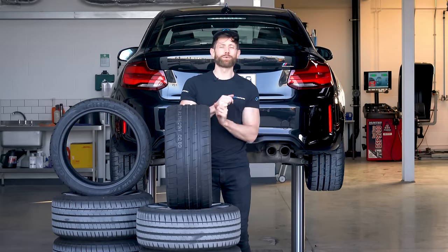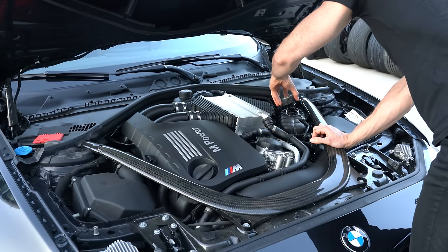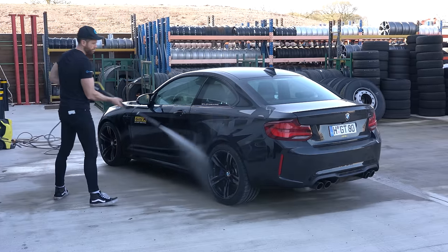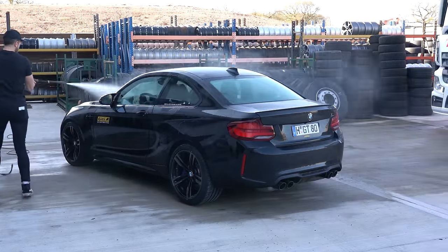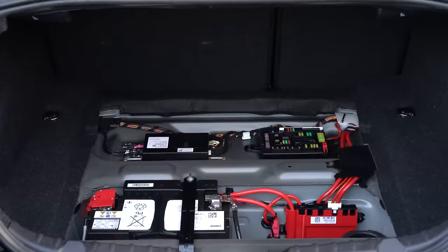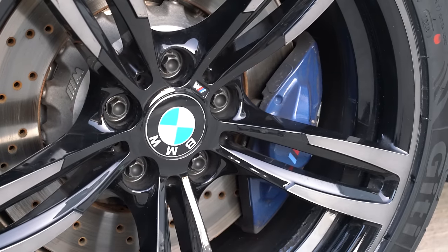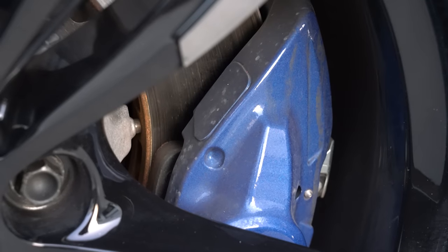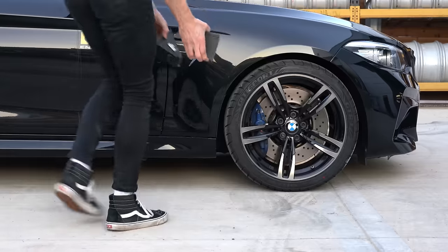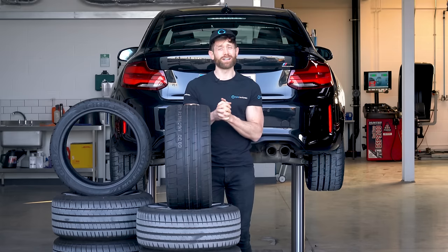Bonus car tips. Now's a really good time to give your car some love. Give it a visual inspection to make sure the doors aren't going to fall off, open the bonnet, check all the fluids, check the oil level and top up if needed, and give it a good clean inside and out. If your car's going to sit for more than a few weeks, invest in a trickle charger to stop it running out of juice. Also, brake pads and discs have a very strange and intimate relationship — if you leave them alone too long, they can fuse. If you can safely, leave the handbrake off, leave it in gear, and chock the wheels to stop the rear pad fusing to the disc, which can cause vibrations and less braking efficiency when you first get back driving.